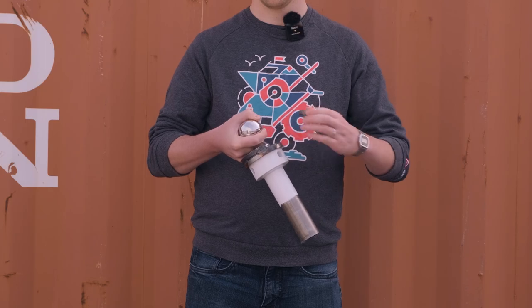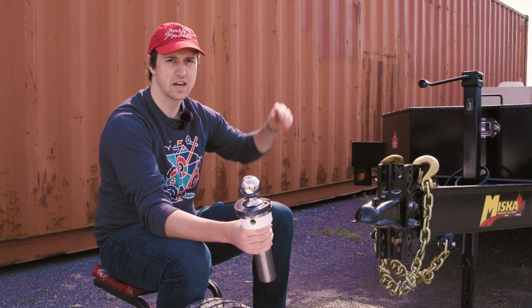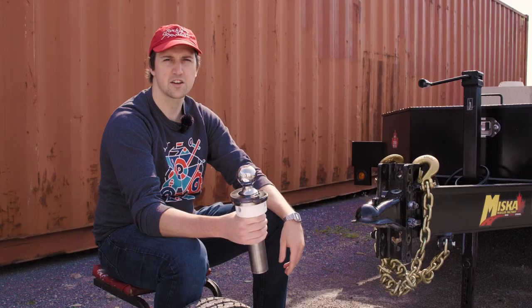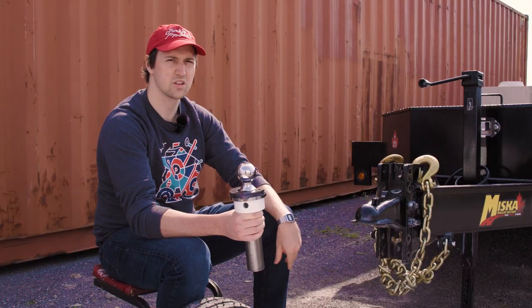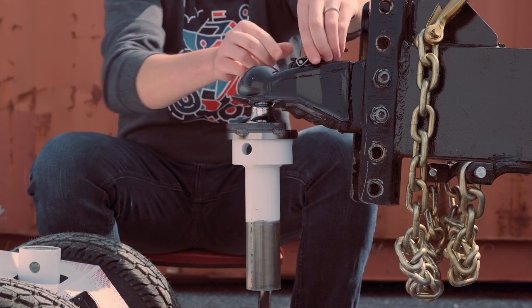To connect with a step-down trailer like this one, remove the puzzle piece from your thrust washer. To install, line up your hitch ball with the welds facing the back left of your trailer, roughly at 10 o'clock. These welds prevent the hitch ball from spinning inside of your coupler. If the weld spots are not aligned properly, you may have problems latching your hitch. Latch the hitch ball into your coupler, then insert your latch pin to secure it.